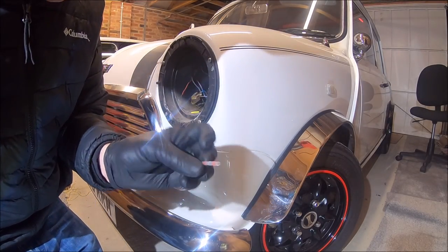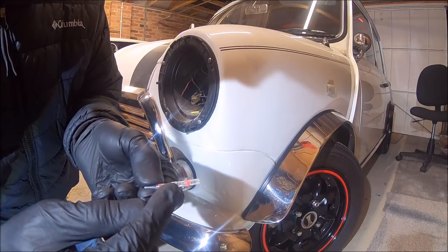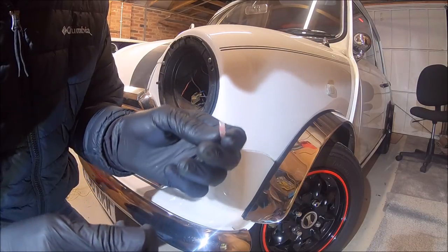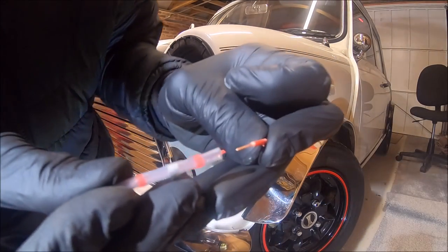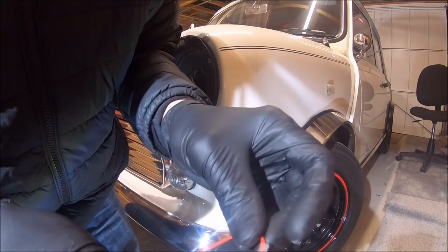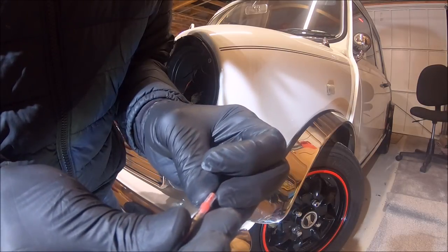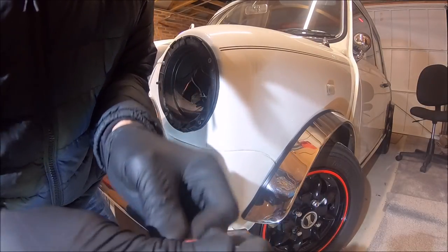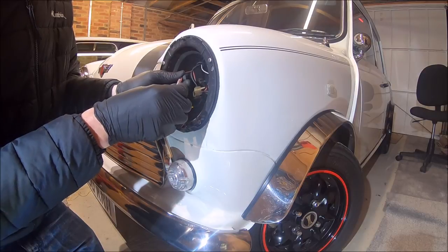We're going to use a special type of connector on this, so it's not a solderless connector. Basically there is a little bit of solder right in the middle. It has two rubber silicone rings at either end, and it's what they call a self-sealing solder connector, I think. So basically all you do, I don't know whether this will show up that well, you poke the wire in through the rubber sealing ring, through the pre-solder bit in the middle, so you get both bits of wire through the bit of solder in the middle, and basically as you heat that up, it seals up the end and solders it at the same time, so you're never going to have an issue with moisture getting into that.